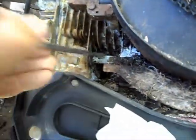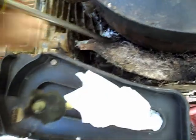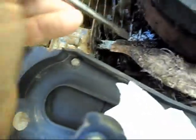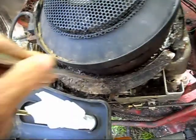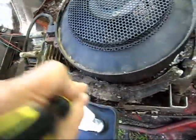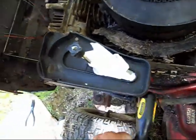Well, quite a bit of corrosion there — probably from mice piss. There's a magnet on the flywheel and this is a piece of metal but it's got a lot of crap on it. I'm going to get a wire brush and try to clean it out. I don't dare try to start this thing. I don't know if it'll run. It did run last time. As a matter of fact, I added a gas shut-off cock over here — I didn't have one. I changed the gas filter last year on that.